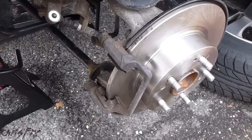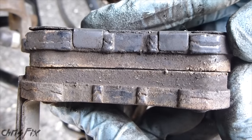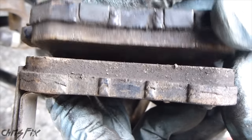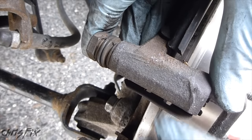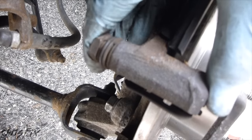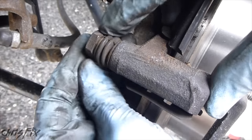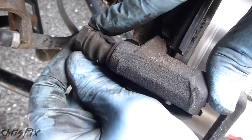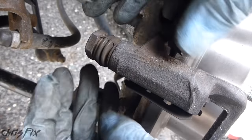The top tip for this video: I'm going to show you what the passenger side looks like. Here's the passenger side brakes — you can see they're worn completely evenly, which is good. That means our guide pins are working correctly and our caliper is working correctly. This is what it's supposed to look like. Here's one of the guide pins — this is without me greasing it, this is factory. Even though this is working, you still want to grease these because, as you see, there is movement, but it doesn't move as easily as after we clean it up and grease it ourselves with brand new silicone grease.